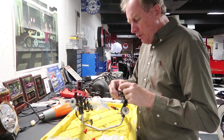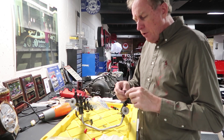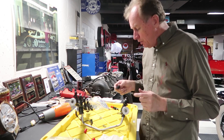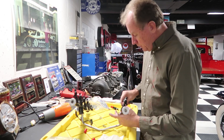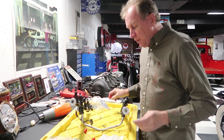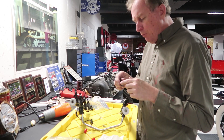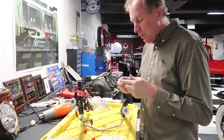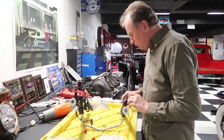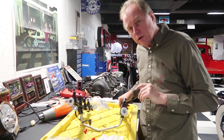What started all this — we were getting a misfire on cylinder 5, which is what the code was telling me. Once we got that misfire code, we couldn't seem to get it cleaned up, so we figured maybe we've got a clogged injector. We're willing to give it a $75 fix. The old injectors looked a little rough anyway, so I don't feel bad about putting some tested injectors in.